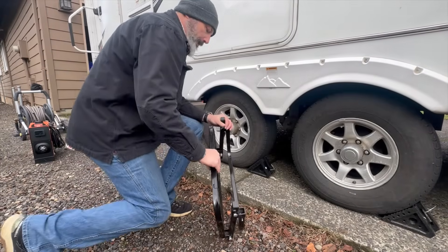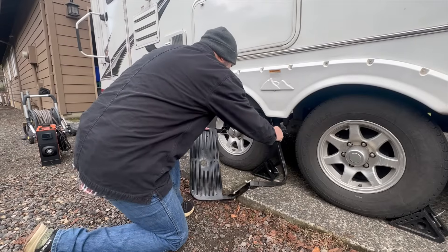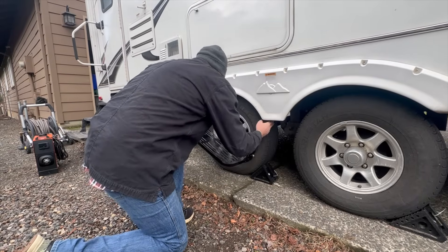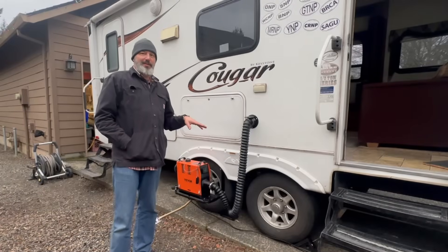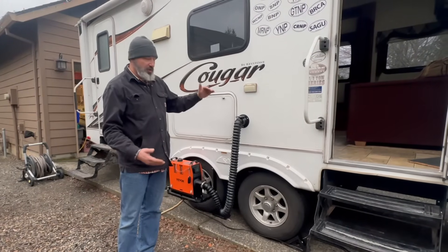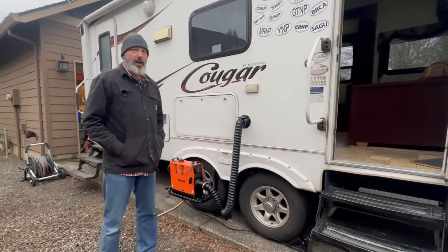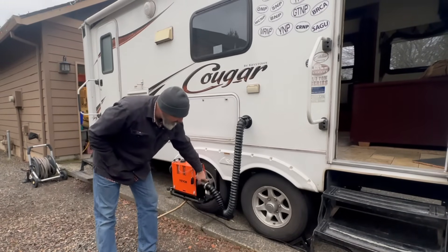There were four lessons I learned when I took this thing out for its first trip. Lesson number one: the tire fenders kind of prevent the tire stepper from simply going over the top of the tire as designed. The way I overcame this was to start at ground level and then rotate it up into position. Lesson number two: once the diesel heater gets up to temp, it will cause the ducting hose to elongate, causing a dip, which gave me error code 05 - an overheating error. I chopped 12 rings off the ducting and it fixed all the problems.